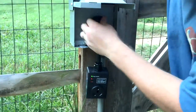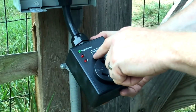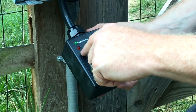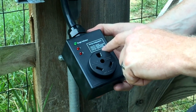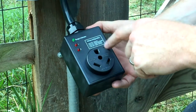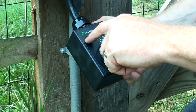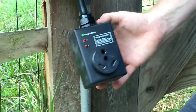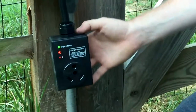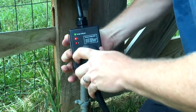You plug this thing in. The first thing you get is the lights. If you look on here, you have a combination of two different lights, and there are four different issues. Right now, the single red light means that we have a good, correct wiring connection here. So if I plug in my camper, I'm not going to short out or blow up anything.